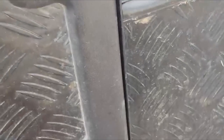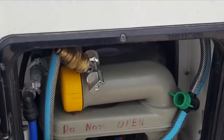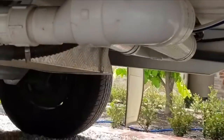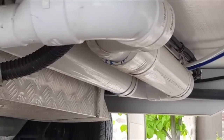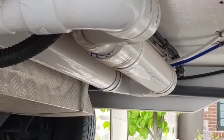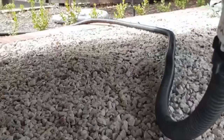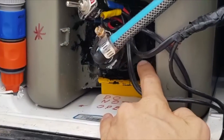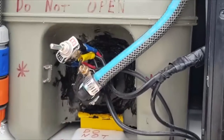I hated the cassette system, so I drilled a 100mm hole in the bottom of the cassette, bolted a flange to it, glued it, and then created another tank down here using 100mm piping with straps. These then go into a macerator unit which pumps out a hose at the rear bar — no need to put it away or wrap it up. For flushing, I have a hose mounted here that goes straight through into a sprinkler head inside, which flushes through the system, with a switch for the macerator on and off.